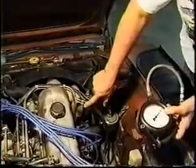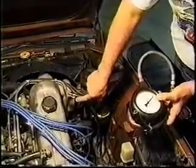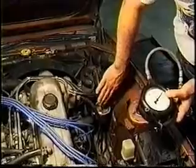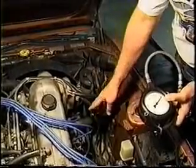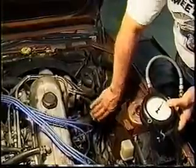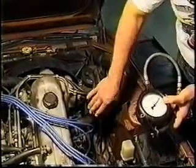This side of the line — if you ever pull it off even when the car is running — there will be so little fuel coming out of here. It'll just astound you that you can go from 50 to 60 working pounds of pressure down to 36 pounds and almost nothing seems to be coming out. It is correctly functioning even if you see very little fuel coming out of this line when it's running.